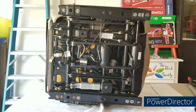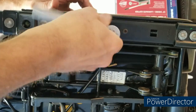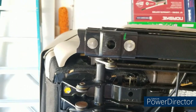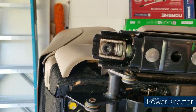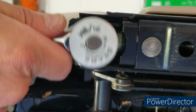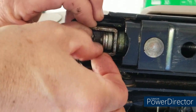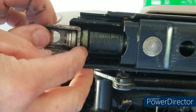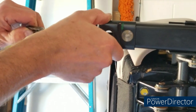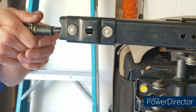Be careful not to scrape anything — it's very awkward. Put it on a surface where it's easy to work. Take out the two T25 Torx screws that hold the bushing carrier to the seat rail, then slide the seat rail forward to reveal the T50 Torx that holds the threaded rod to the seat rail. Remove that, then slide the rail back — it will only go back a certain amount, then you'll need to slide the rail itself back to release the threaded rod.